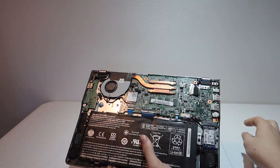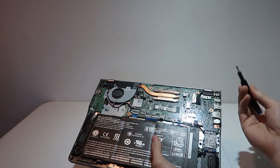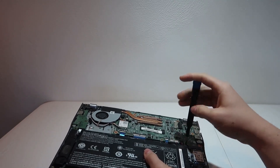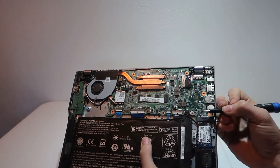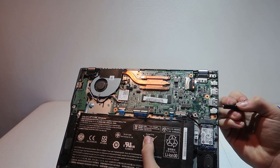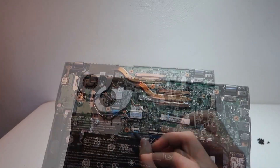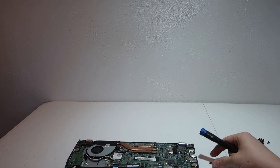Now that we're in the machine, we can go ahead and locate that write protection screw, which is right here by the battery and the SSD. In some models it might be elsewhere. The easiest way to find it is to remove it - where the write protection screw is, you'll see there are all kinds of pads. Those pads basically tell the Chromebook if the screw is there, and therefore it knows if write protection is enabled or disabled. Look around your motherboard and find those pads. Once our write protection has been removed, we can go ahead and put the Chromebook back together. I would not recommend putting the screws back in until everything is fully installed, as I would recommend putting that write protection screw back in when we're done.